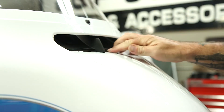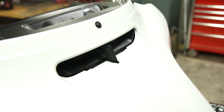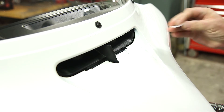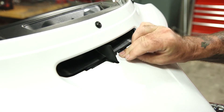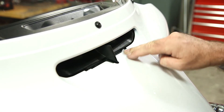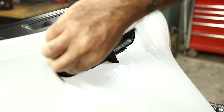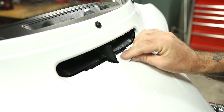There's a little bit of adhesive there, not too much. I've got a little adhesive remover, so I want to get this stuff off so I know when I go to put the new adhesive on, it's going to bond properly. If this bike had any road time on it, I would wash with warm soapy water and then dry, but this bike has no miles on it. It hasn't seen the road yet, so I'm just going to make sure there's no wax or anything right in this little area with the alcohol swab. It'll be ready for installation.